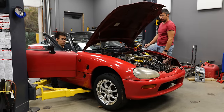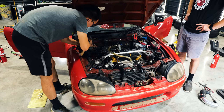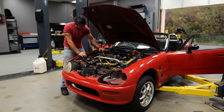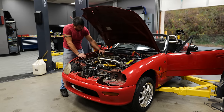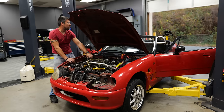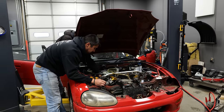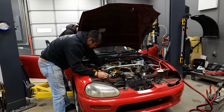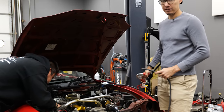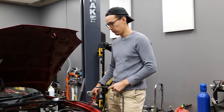No, it won't crank the starter. Oh, we had to tap the starter before. Didn't we? Yeah, when I went to Automotive Aesthetic. Not even trying. I'm not seeing any signal. Basically what we're doing is just bypassing the starter solenoid switch to see if that's the issue.